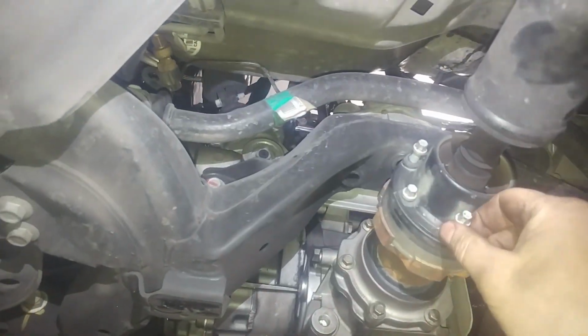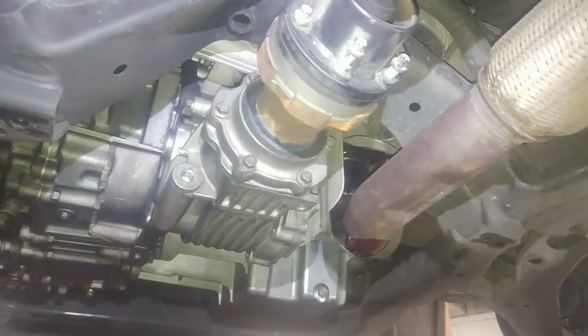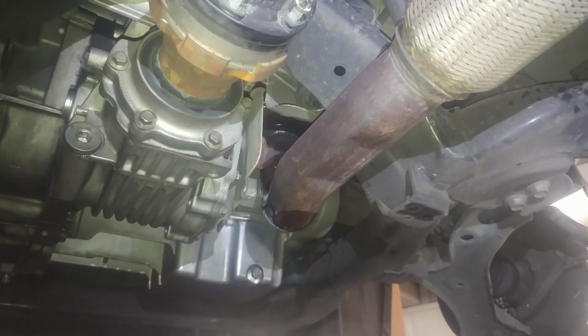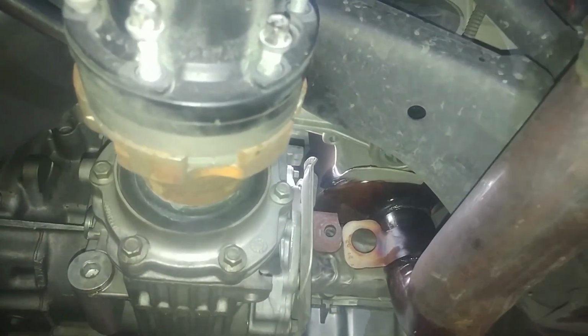I want you to remove it, I do know that, so that's what I'm going to do. Got these bolts loose here, 8mm bolts. Again, everything's left to loosen, right to tighten. Left one in there till I'm really ready to get it out. But while I'm dinking around down here, break some bolts loose. Yep, alright, exhaust is coming out. Alright, I got a long extension, 15mm swivel.